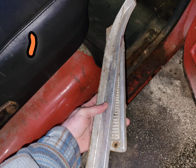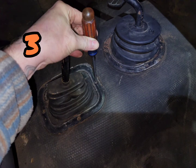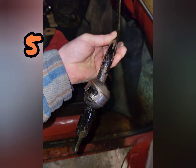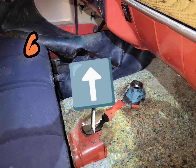Remove the passenger side carpet trim. Take off the four-wheel drive shift knob — it's in your way. Then take out the shifter boots. Here they are removed. Push down and twist to remove the shifter from the transmission. Push the floor mat over and out of your way.